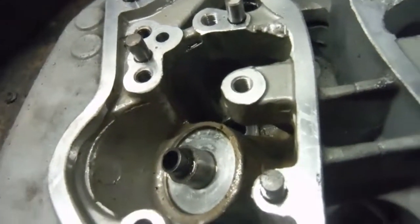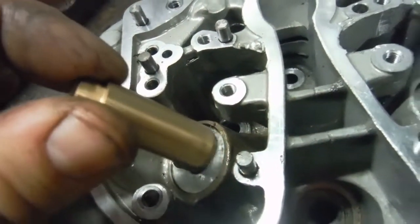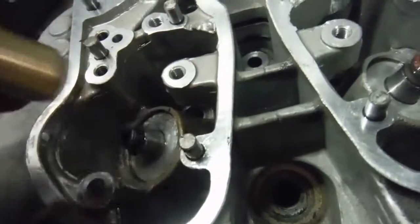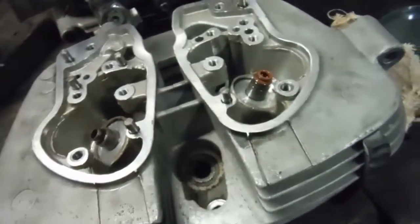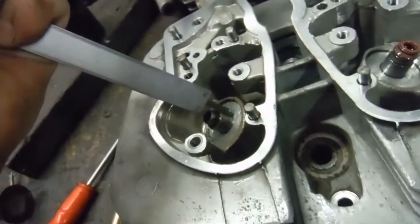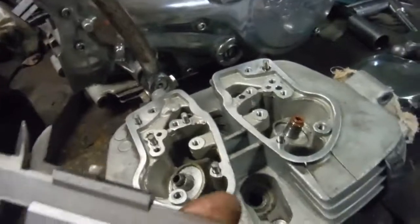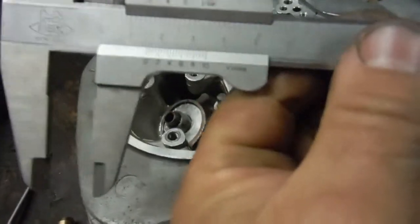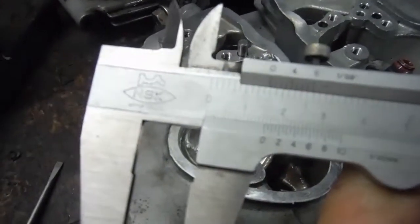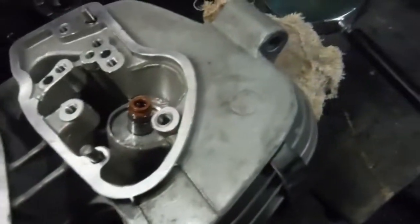It's going to be interesting because obviously I'm going to have the cylinder head hot and be driving the new guides in as quick as I can. But you've got to pause with this one, measure, and see how far the guide has gone in to know whether you need to go further — and hopefully that you haven't gone too far. Just for reference, the overall height of the valve guide sticking out from that side of the cylinder head seems to be 15 millimetres, so that's what I want to aim for when I drive the replacement in.